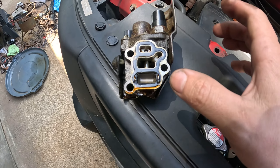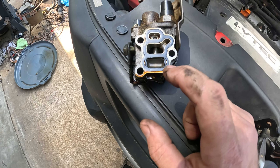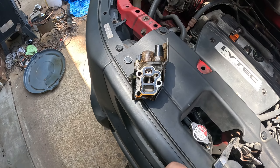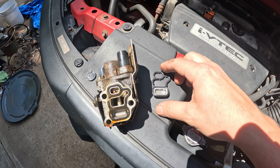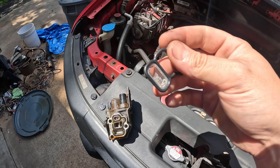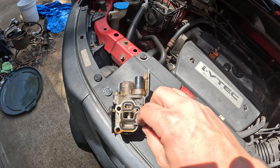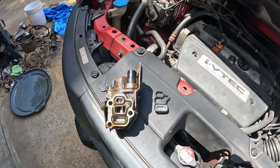Another reason this can malfunction is the screen can get full of junk. I think this one is off my spare motor and I just cleaned it out with brake cleaner and put it back in. Sometimes you can get away with that, sometimes you can't. The new one we're putting in is all new everything. This is our new gasket right here. The screen looks pretty beat up, but that's just the way it came out of the pack — not super happy about that. If you have the option and you're not in a huge hurry, you can get an OEM one and they're normally a lot nicer.